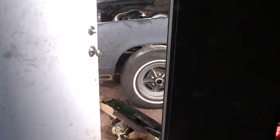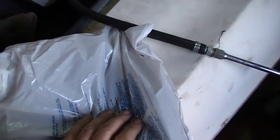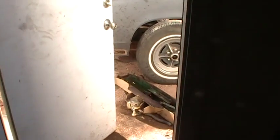The second thing is, as I was doing this, it's going to push air out of the rim. There's going to be air escaping between the tube and the tire. But using water, you know for sure that you didn't pinch a tube, because if you don't see a bunch of water coming out, it's pretty much good to go. Same thing with right now. If I start seeing water coming out of the tires or a puddle in the water and it hasn't rained, I know the tire's leaking. But there you go. I'll let you go.